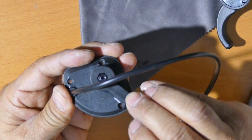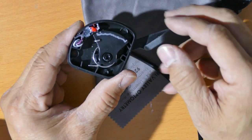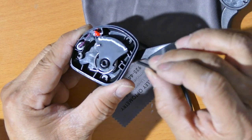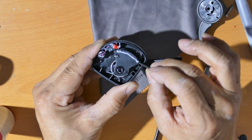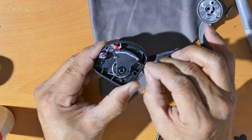That translates to basically where the throttle will actually start responding. I'm going to put in a set screw - something like this - so we're going to drill a hole and be able to put in a set screw right here. I should be able to adjust how much I want it to go in.